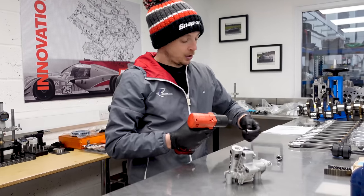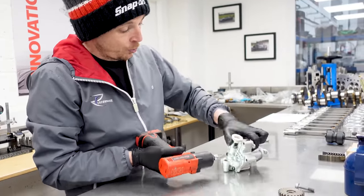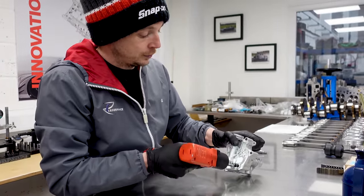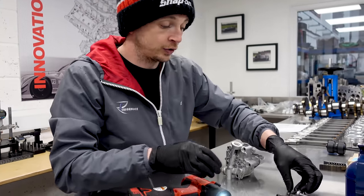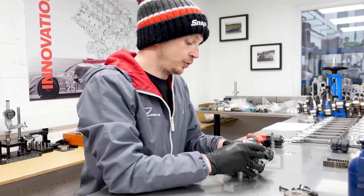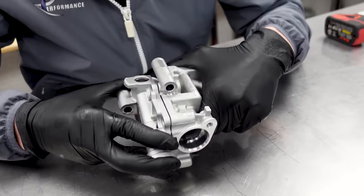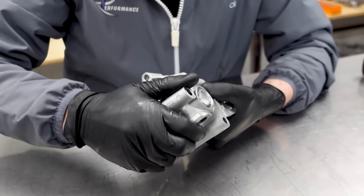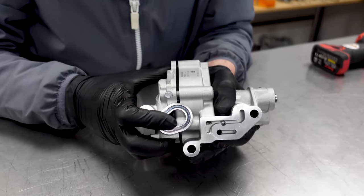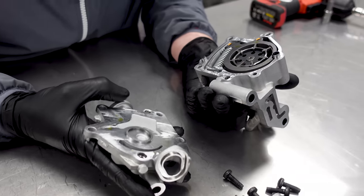Let's just buzz these bolts out - they're just T30s. We swap these bolts for cross-drilled head bolts, so we change the heads. It's on two little dowels. This is where I pull it to bits - watch, just wiggly wiggly, you haven't got to use a tool or anything. Let me see it just come off the dowels. Nice and gently - there we go.